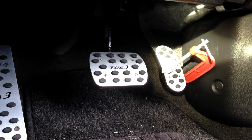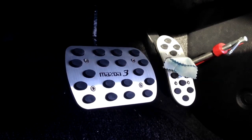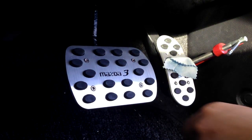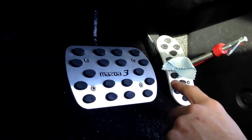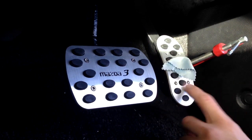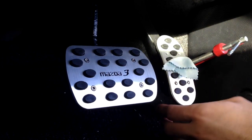I'm going to make sure I measure it right. Now I'm going to start the drilling process — I've got it where I want. A key point for my Mazda 3: on these two sides, behind is actually a quite thick plastic block, which is blocking me from putting the bolt through. So I'm not going to bother putting bolts on this side — I'll just do two bolts on the right side. Hopefully that will be enough to hold it in securely.